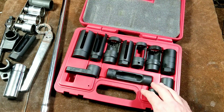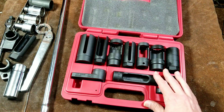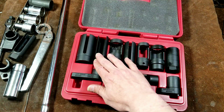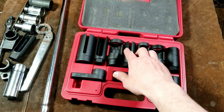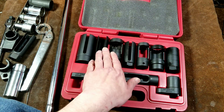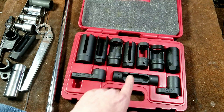This is a 10-piece set. You have six pieces in half-inch drive and four pieces in three-eighths inch drive — kind of an eclectic drive collection. Some of them have hexes, like these three sockets here. One's an oil sensor socket, one's a diesel injector socket. The thin cut is just for the fuel line to pass through on a diesel injector, but a lot of these are seven-eighths or 22 millimeters and will certainly work for an oxygen sensor if you can pass the wire through.